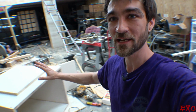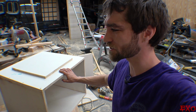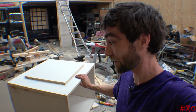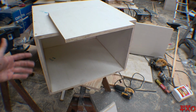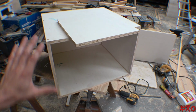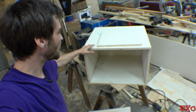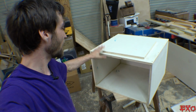So we're gonna get Remy in here, get some ported box madness in the back of his, I think it's a, what is it? Is it a Tahoe or a Suburban? It's something big and black and I love it. We got the port inserts ready to go. The front baffle will be doubled up, sub back, port back configuration. Just something that'll work well since everything's gonna be facing the back anyways. Made sure to keep the design nice and narrow. That way we could position the thing in all sorts of ways in the back of the vehicle, try to get that sweet spot for the bass.